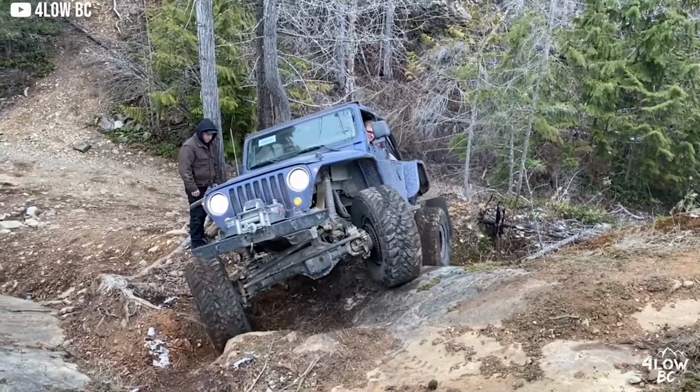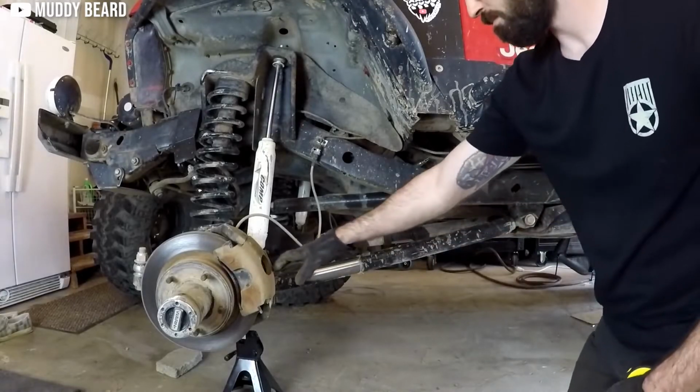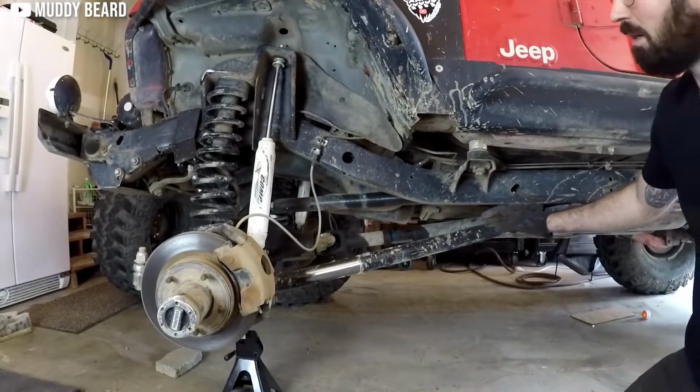Aside from the price tag, a downside of the long arm lifts is their tendency to hang up when crawling over large obstacles. In order to make the angle of the arm smoother, a long arm lift must attach further back on the vehicle, which takes up more space than a short arm and can create some unwanted ground clearance issues, especially when rock crawling.